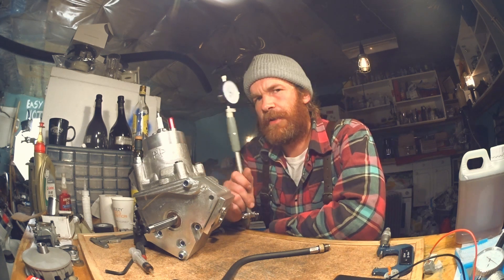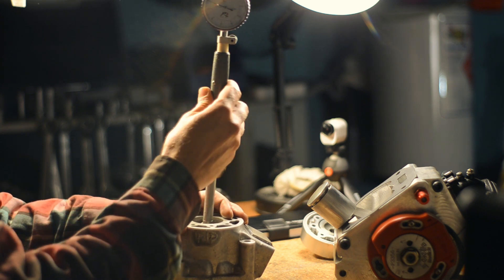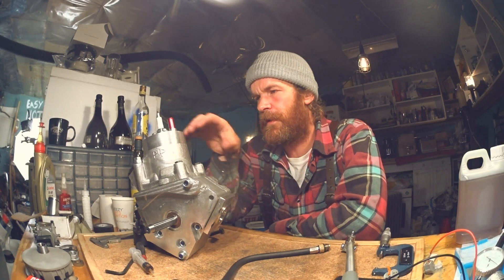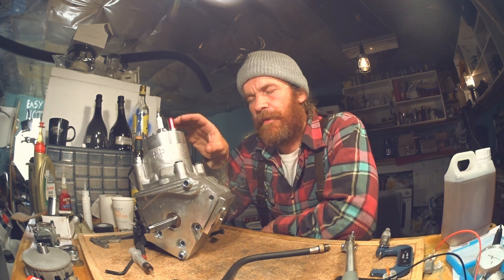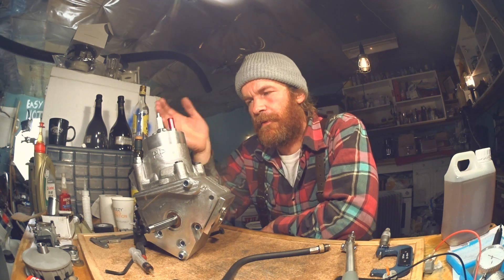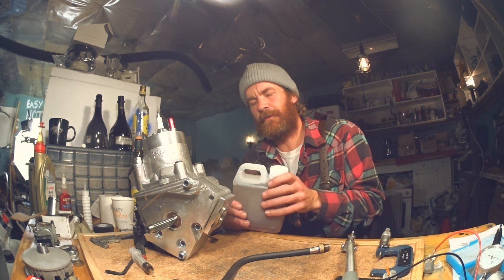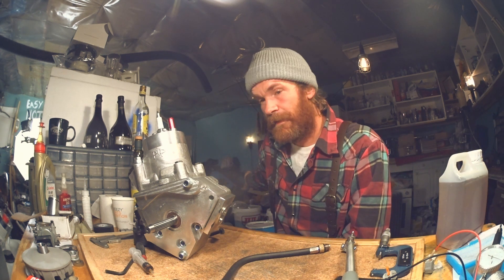We need to build this valve. I checked the bore — it is fairly round and hasn't worn much at all. But that black-grey stuff has to come from somewhere, and I suspect it's probably a combination of the ring and the bore. We saw that little spot that wore off, so we have to decide now: either get this bored and plated somewhere else, or use — for legal reasons I'll call it definitely-not-nitric-acid — to strip the nickel and try another plating here.